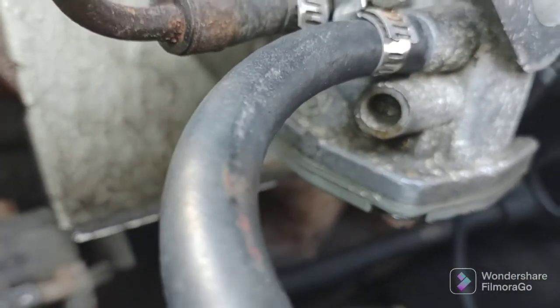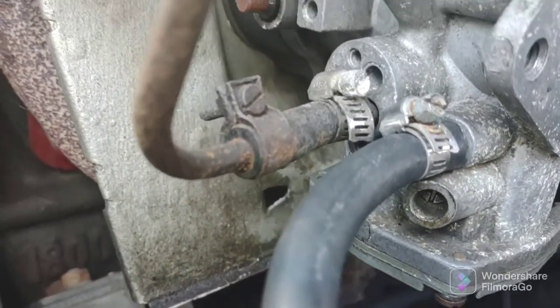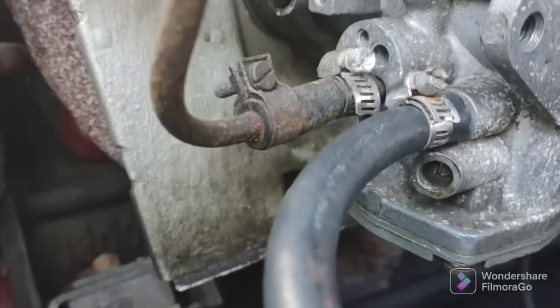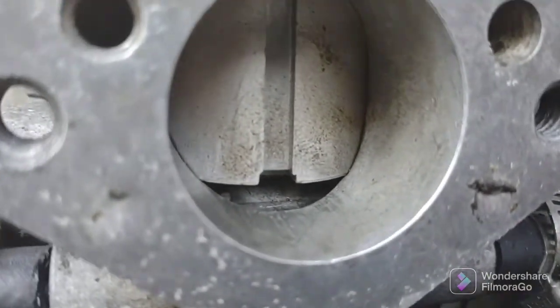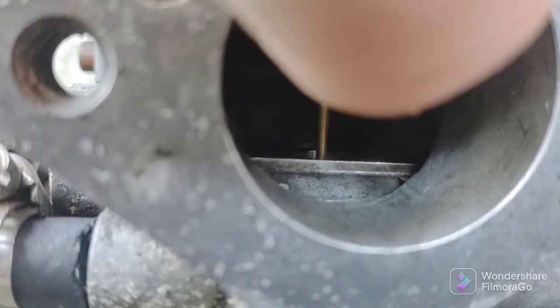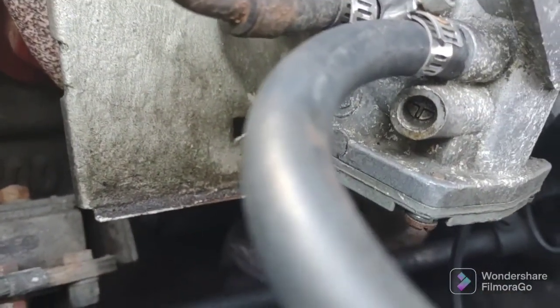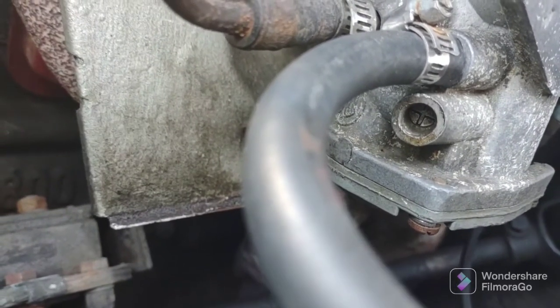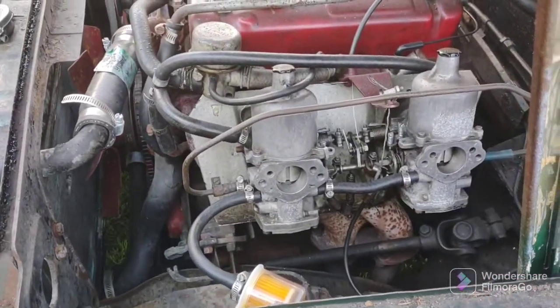Okay, so I'm gonna bring them to a starting position and then turn the screw. Starting position is when the top of the jet is even with the bridge. At least that's what I learned on YouTube. And then two full turns of the screw inward will lower the jet the appropriate amount, and that should be a good starting point for both carbs. So we'll give it a shot.